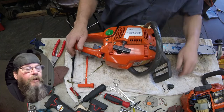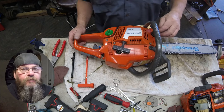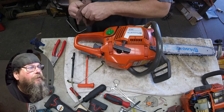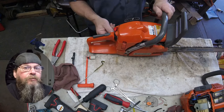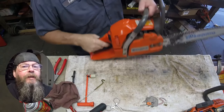This thing is going to probably start up and smoke really bad but eventually clear out. If it wouldn't clear out, we would start pressure testing the crankcase and the oil tank and make sure that gasket in the crankcase is good. That's all I've got for you on this Husqvarna 353 chainsaw with the gas and oil tank contents switched — thanks for watching, later.